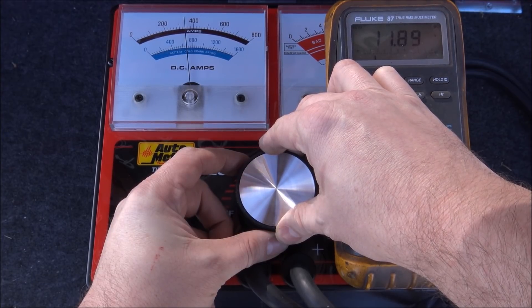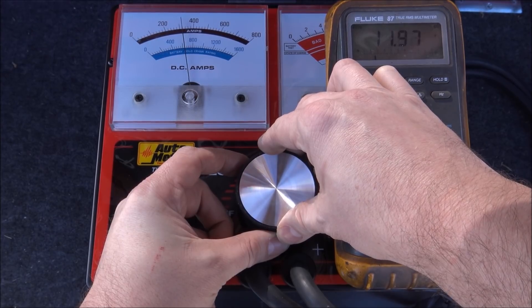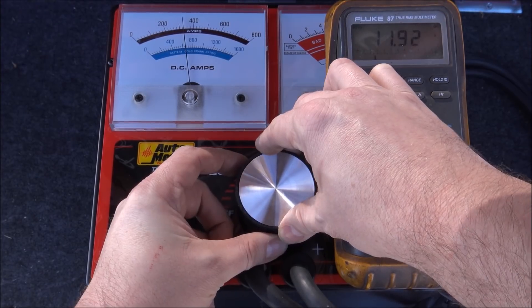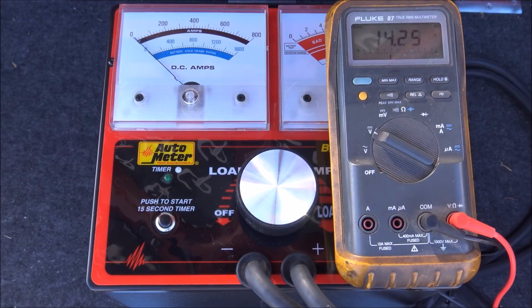As noted, this is an extremely tiny battery serving as the rear bank here. In the 12-volt area we are sustaining a continuous 325 to 375 amps. So we can safely say a continuous 350-amp draw will be no problem for this setup in a musical condition at idle RPM speeds. And remember, we are only utilizing about half of this alternator's power output capabilities in this Part 1 series of testing.